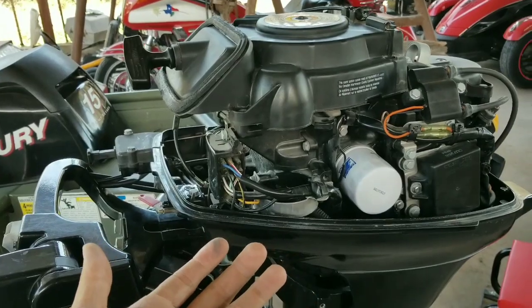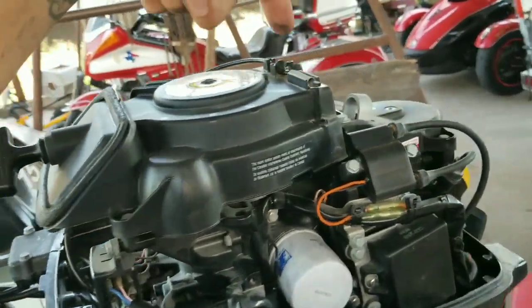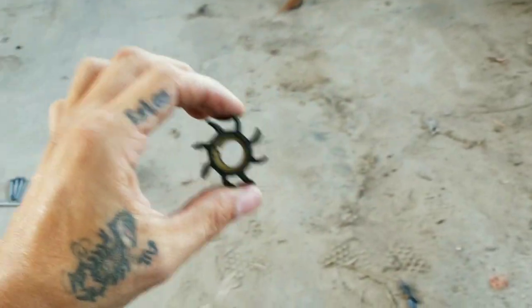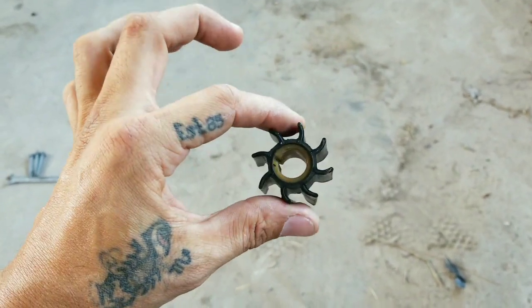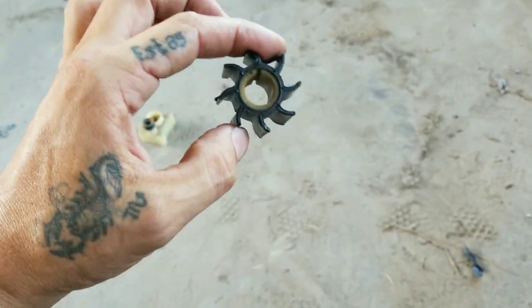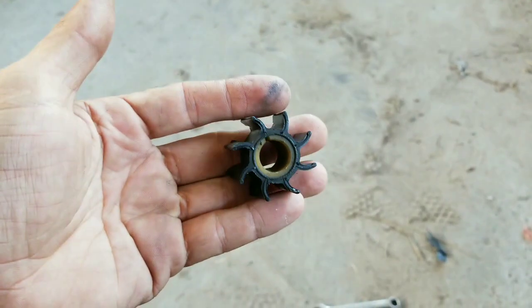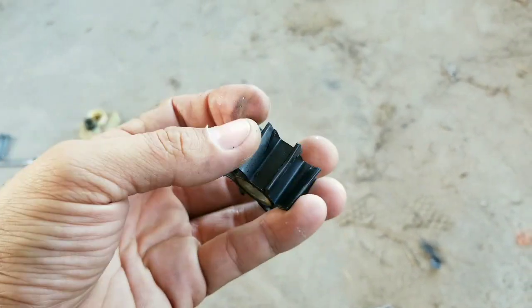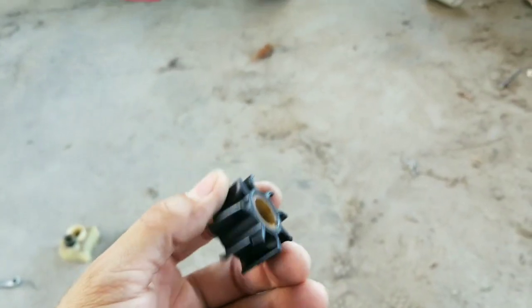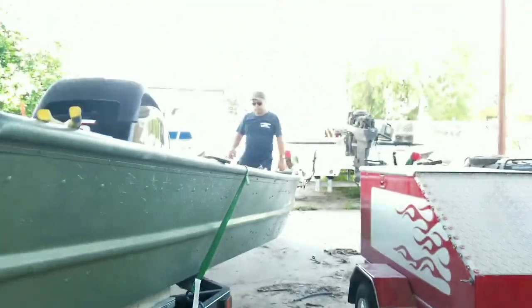If you know where I'm getting at, right? The engine can't turn clockwise, and then the impeller on the bottom turn counterclockwise. It's just impossible, right? Because it's connected directly onto the engine, straight shaft down onto the impeller. So if you have a counterclockwise turning engine, keep it, because I guess you would have the only one. But I'm just giving out my experience here. We do these for a living, and just thought I'd let you guys know. I haven't seen a counterclockwise turning engine. Maybe, I don't know, let's ask.